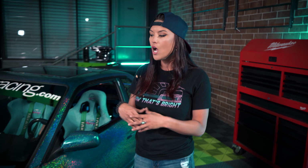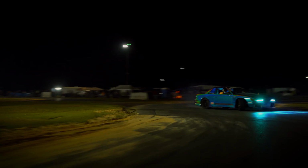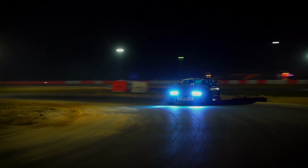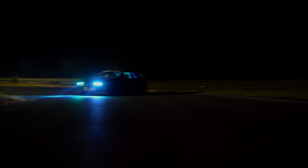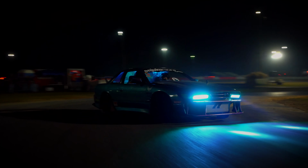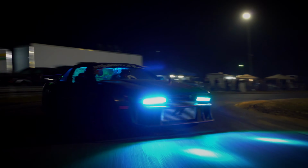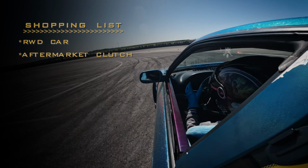If I was you, suspension wise, I would recommend coilovers because there's a lot of adjustment that you can do. On this car, I'm running the Yellow Speed Pro Dynamic Drifts. Other than that, lower control arms, upper control arms, and also an angle kit, so you can get the adjustment in the angle that you need while drifting. Because if you have stock angle, you can't get that really hard initiation, getting that car sideways like that. So the more angle, the better the initiation.